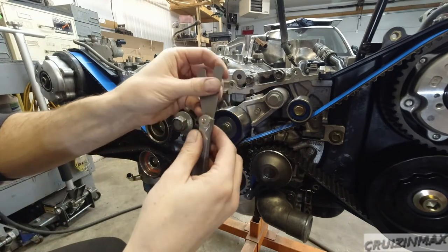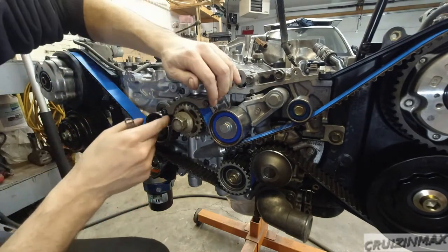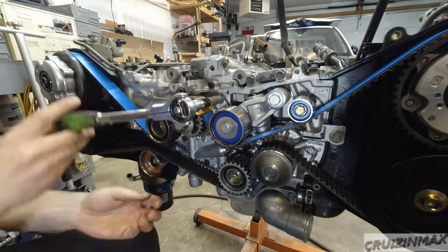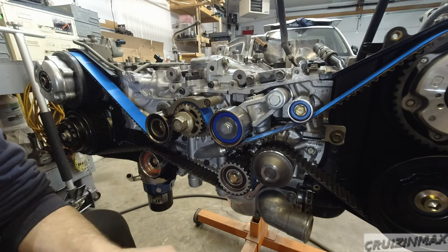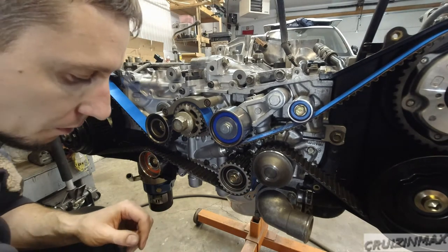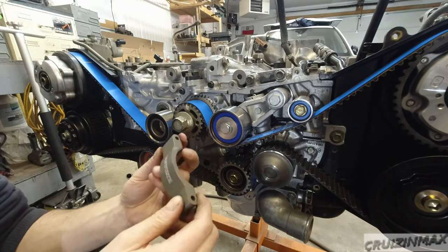So I can go to 0.04. Let's change these two — go 0.21 and 0.20. Okay, this is better. No, it still doesn't fit. I'm kind of scared to use this; it's very close. Let's see if a credit card will work — okay, it goes in with no issues. I suppose I could drill the holes out a tiny bit to give me more clearance. At 0.205, half of what I need is not enough. I'm afraid the belt will wander and keep scraping this and eventually break. I'm going to drill these out just a hair.